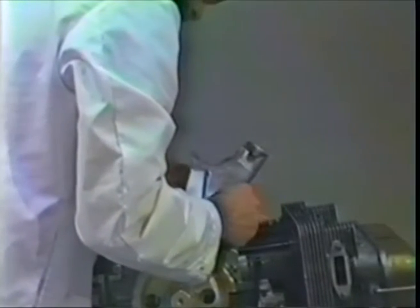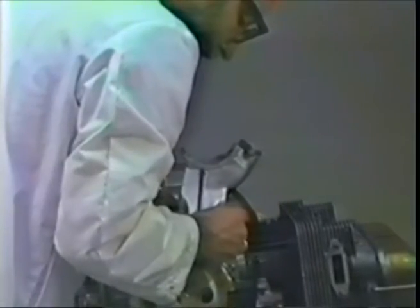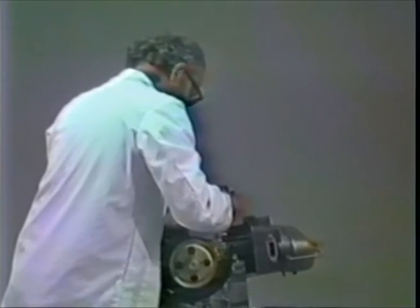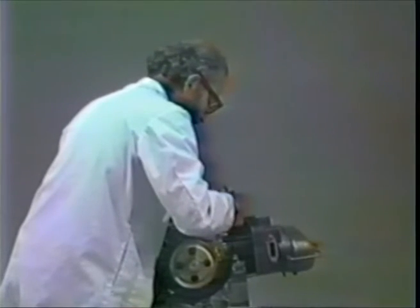At first, screw them down a few turns. You sometimes have to rearrange things here a bit to get both the gasket and the stand lined up. Murphy tries to make you miss the holes. If you give up, just take off the generator stand like so. Carefully set it down from the top, and we'll find these holes here. There we go. Use the next best one on the rear of the engine. Rear is towards the rear bumper. Front of the engine is towards the front bumper.